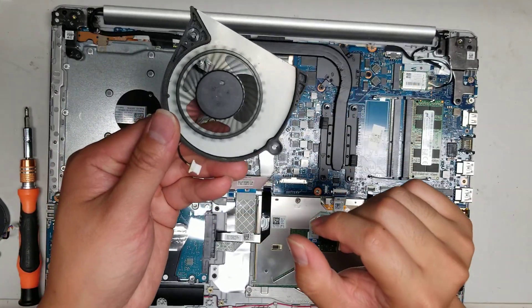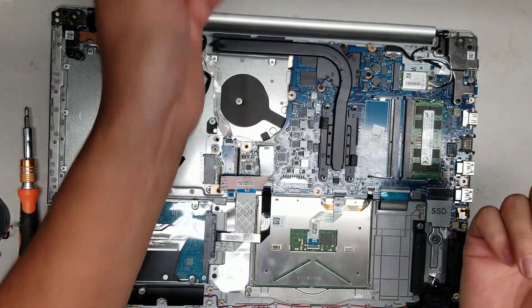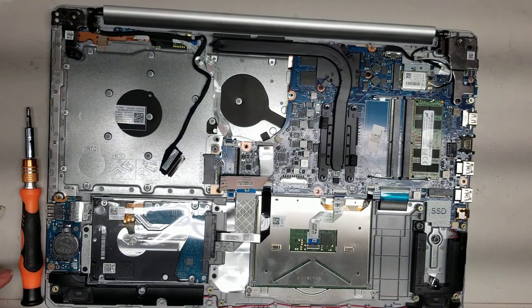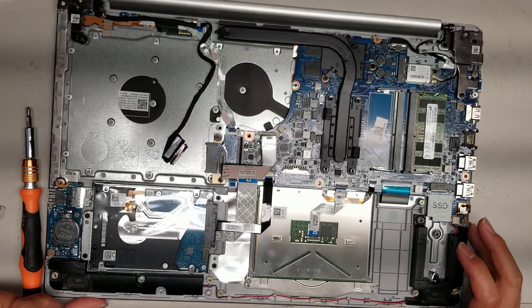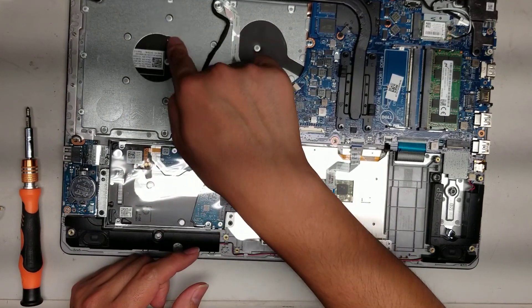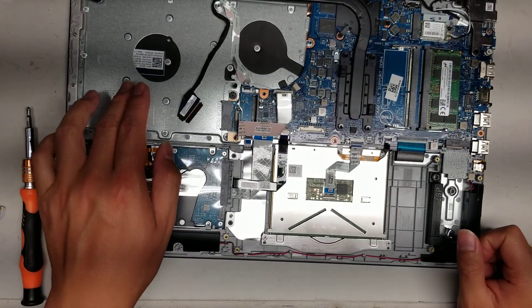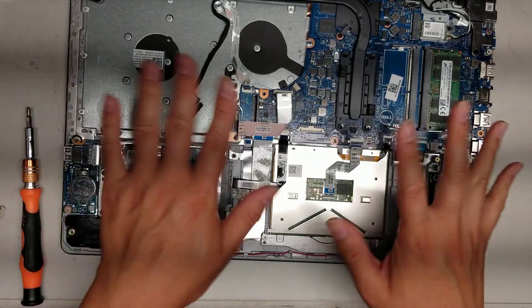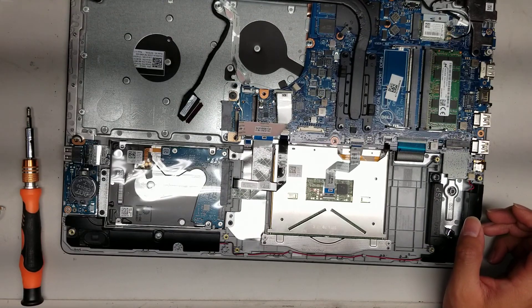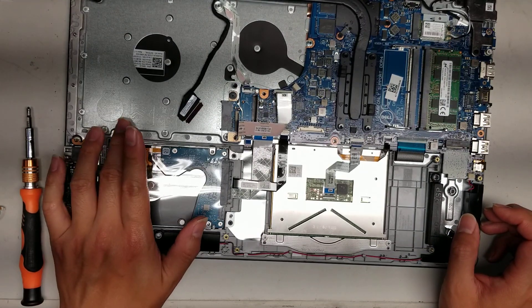Hopefully after that you can pull the propellers out and add grease, because this fan doesn't spin freely. By comparison, here's how a normal fan would spin — I turn it and it keeps going. So yeah, this fan is bad. I'm not going to take the whole motherboard out. Also, the keyboard is melted in place with these plastic bits, so if you need to change the keyboard, it'll be a lot easier to replace the whole palm rest assembly. Putting back these melted plastic things requires a special tool or maybe a 3D printer pen — it's a pain.